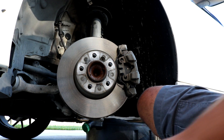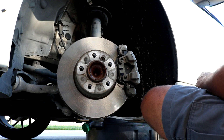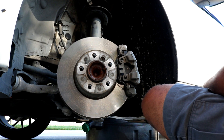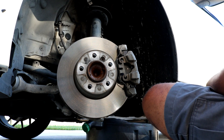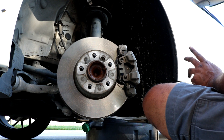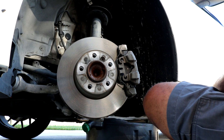Okay, so I got that back on. When you go into the car, don't start it — just press the start button twice so all the lights come on the dash, then depress the brake pedal to pump it up and make sure it gets firm. That way the pads are back to where they're supposed to be and the fluid level will drop in the brake master cylinder reservoir. Then obviously just repeat that for the other side and you'll be done.